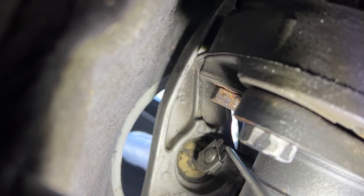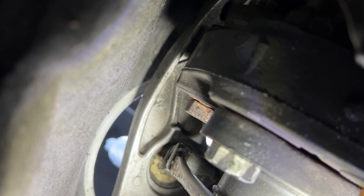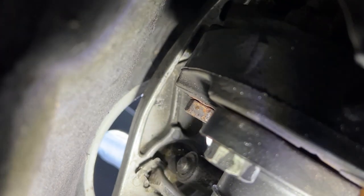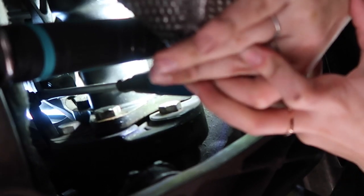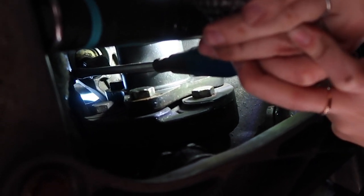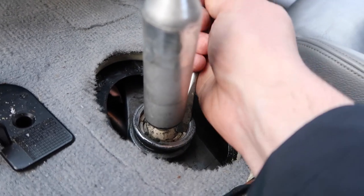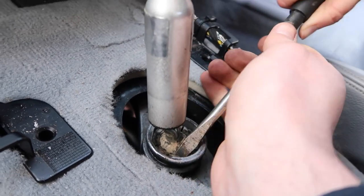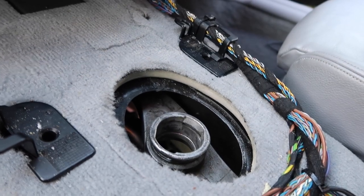This is the clip you have to take off. We need to get a long screwdriver to try and pop that out. Oh my god, I'm moving the whole shifter — I can see it! At this point it's actually easier if you get somebody to hold the gear stick from inside the car so they can push it the other way to what you're pulling from. It needs to be a certain amount clockwise for it to pop out.